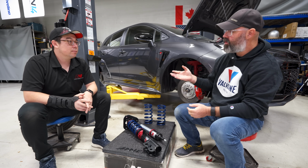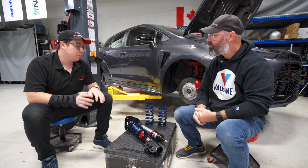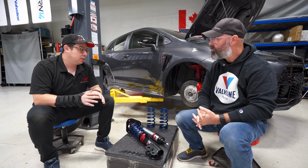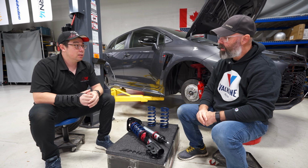And you're choosing your pistons and shims obviously based on the spring rates and the customer's needs and all that kind of stuff. And that's assuming all that is done. But even after I spec that, it can still be a challenge just to make the shocks match themselves, until we started developing very precise internal parts that build it all together.